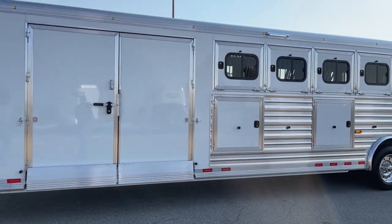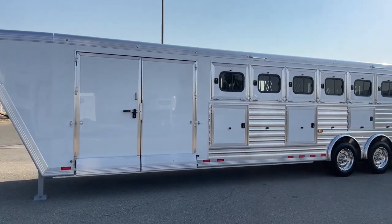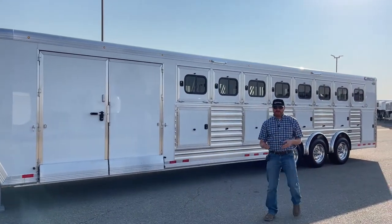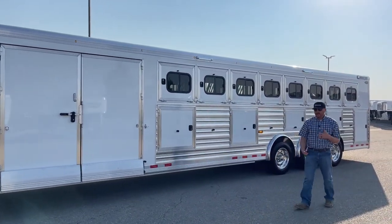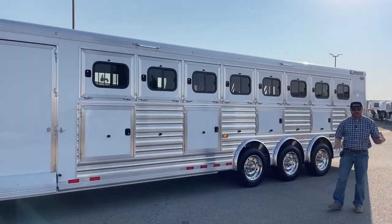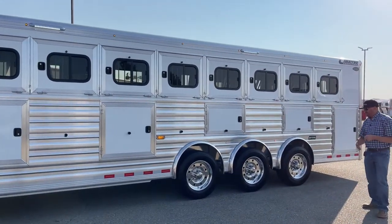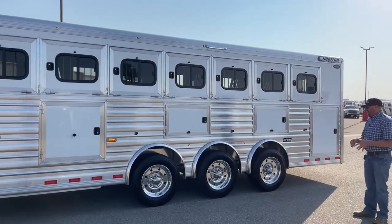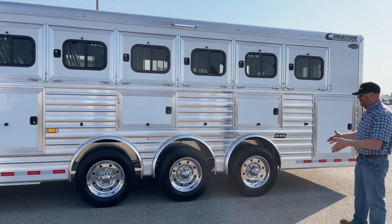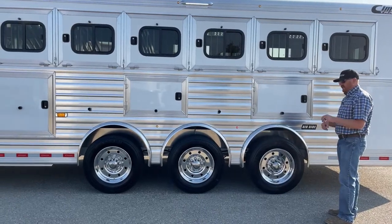This is a big air ride trailer. There's one more piece to discuss about the air ride. Turning triple axles is always more difficult, especially in tight areas — particularly on asphalt. Triple axles put a lot more stress on the axle itself, the hubs, and the sidewalls of the tires when you really try to crank those trailers around. All three axles are actually fighting each other as you're turning in tight quarters.